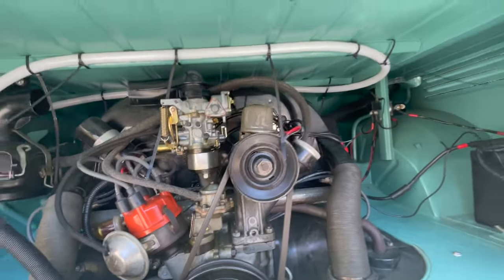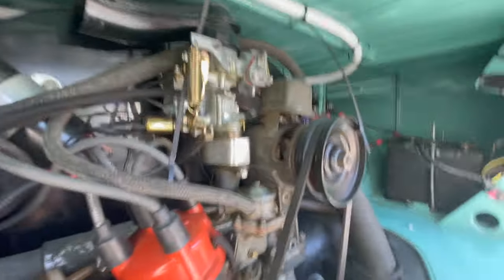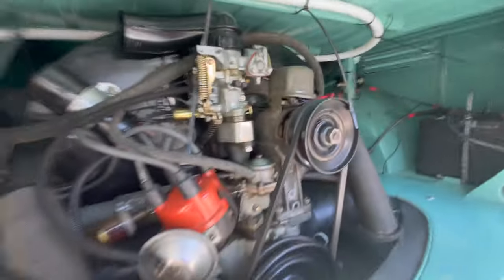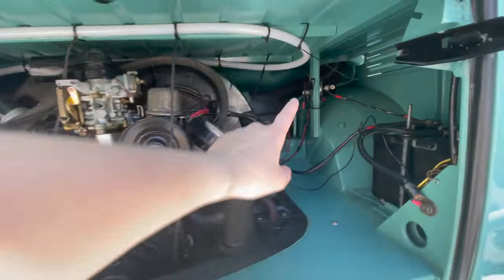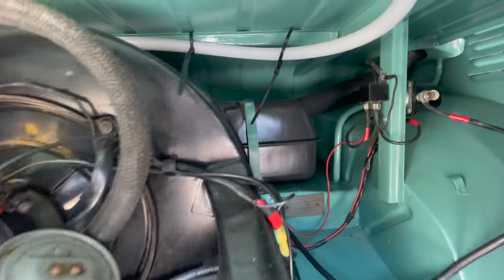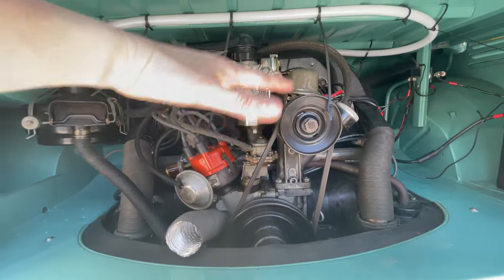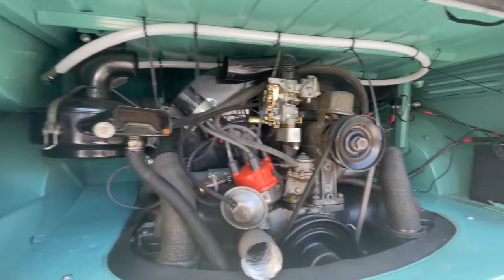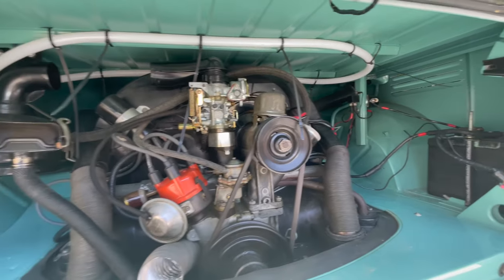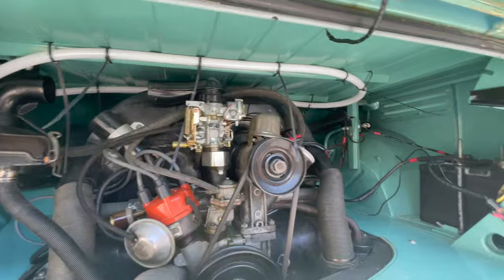And you can put this anywhere you want. I mean, it can go on the deck lid. There is a spot up here on buses. You can actually make your U come closer to the front. But my theory is you've got a 10-gallon bomb sitting right back there in the form of a gas tank. So if we can suppress it before it gets back there, that's kind of my theory why I put them in this way. So let me go ahead and tighten everything up. We'll get it adjusted and I'll show you what it looks like when it's all done.